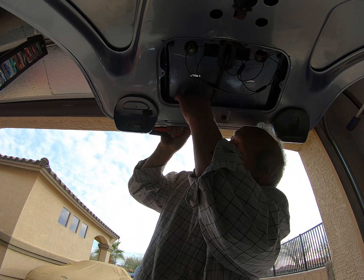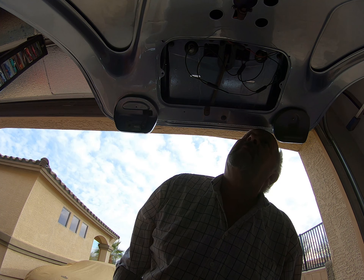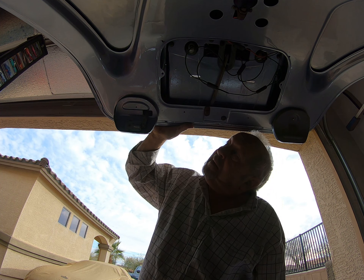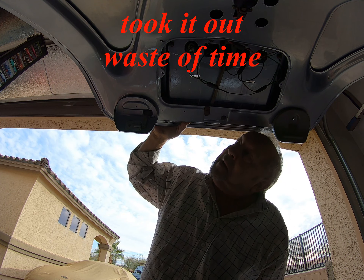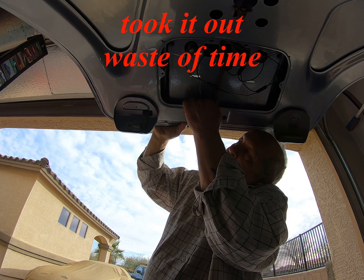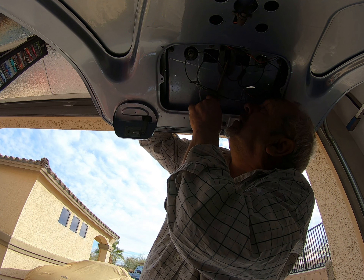This pulls down. I'm hoping there's something I can adjust, but it doesn't feel like it. Maybe I need to take it out and do some kind of adaptation. I'm going to have to take all this out and see - maybe there's an adjustment, maybe I need to move it this way. That's flat - yeah, that's flat, that's what it is. And that's badly worn. I'm going to have to take that rod off, weld it up, and re-drill it because there's a lot of play there.